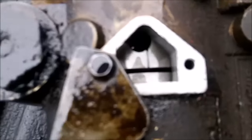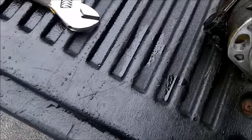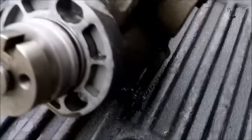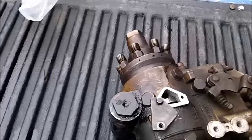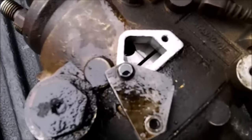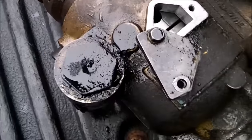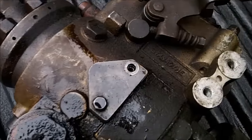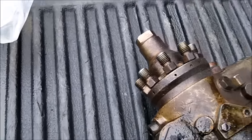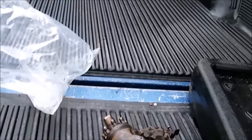A pyrometer is really good to have if you want to tune the pump. I haven't turned the new pump up yet — it's still on the stock setting — so I'm not going to adjust it until I get a pyrometer. I'm probably going to turn it up no more than one and a half to two flats. Even a small adjustment makes a slightly noticeable difference in power — you still get a few extra horsepower, which is nice. That's it for this video, thanks for watching.